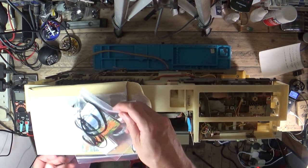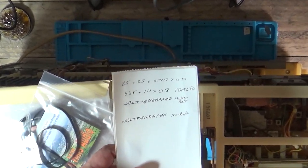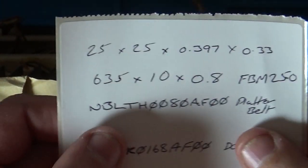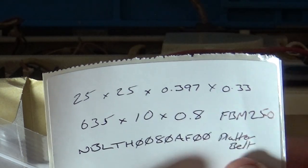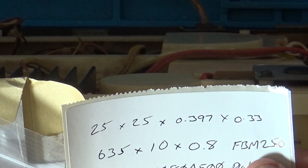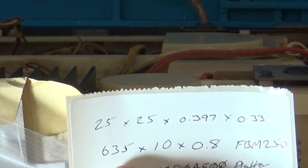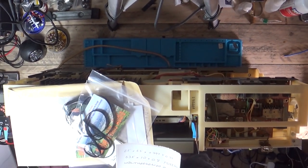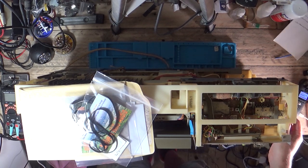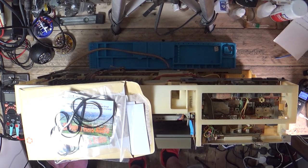Both packages were about £15 each, so I got them both for £35 delivered. I just hope that belt is long enough. I've got the service manual for this and I found the part number: MBL-TH-0080-AF-00 for the platter belt. It's an FPM 25.0, which is basically a 25-inch belt, working out to 635mm by 10mm by 0.8mm. I've got a subscriber asking me for the size of the belt and wants me to measure the platter.